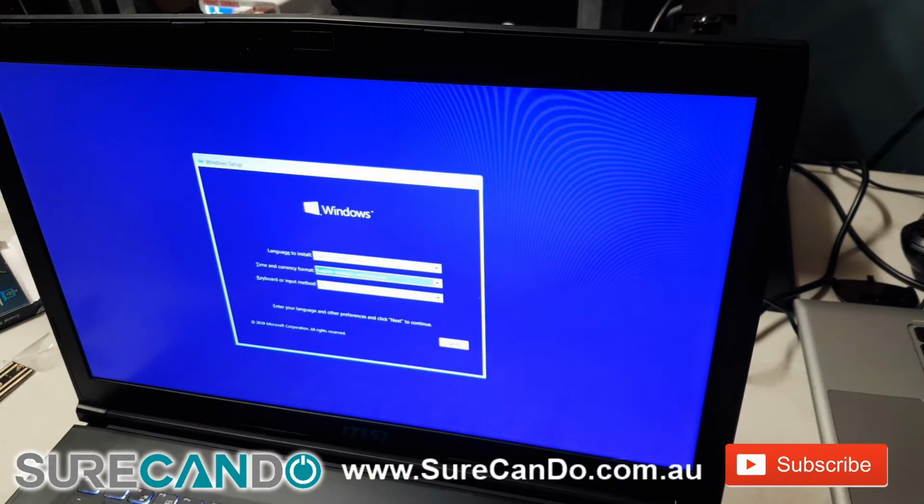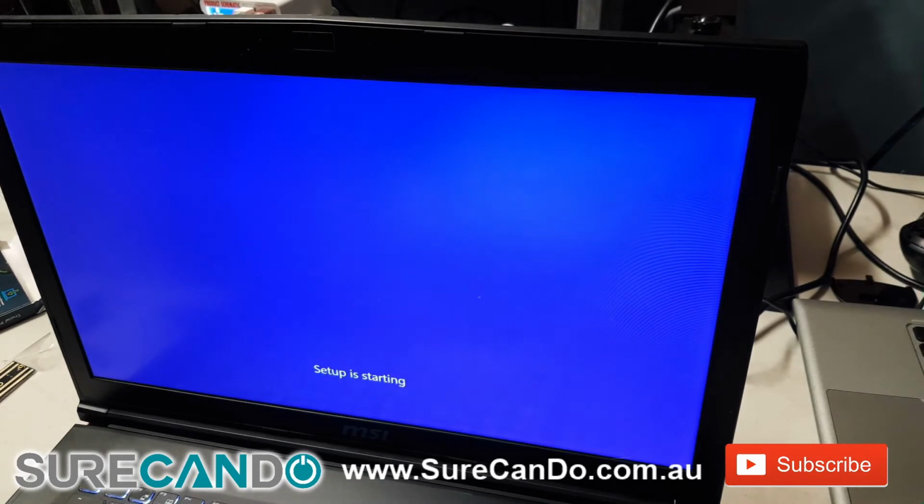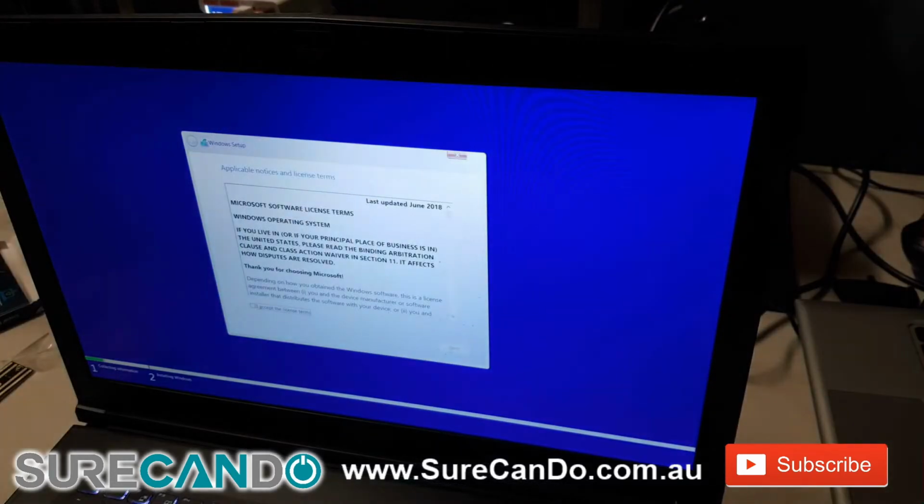And you don't need a serial number, it's built into the motherboard, so it will pick it up automatically and activate Windows automatically. And if anyone out there has a solution where when you clone a SSD from M.2 2280 to NVMe and find a way to fix the Windows boot, I'll be very happy to hear about it, as I haven't found a solution yet.